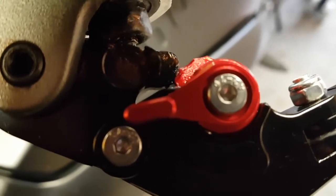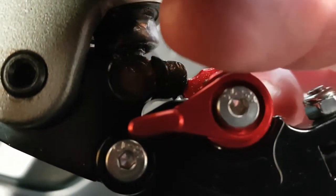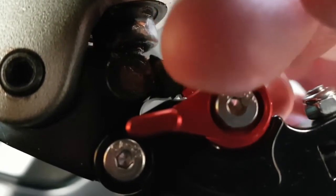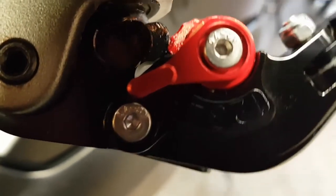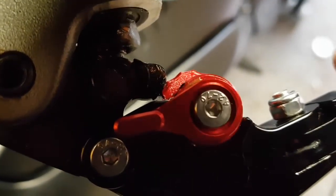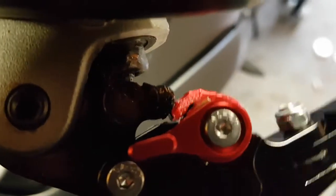So the way to hold the rubber out is just get some thin nose pliers and gently, either side, pinch the rubber, and that just squeezes it down, and it just seems to poke out this way a little bit, and then assemble the lever and push the plunger in. If you don't do that, it's going to have a sort of dimpled effect. This rubber will be further in towards the cylinder, the brake fluid cylinder, so make sure that's correct.